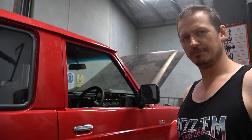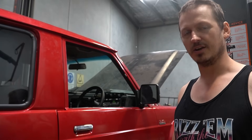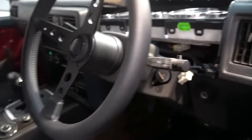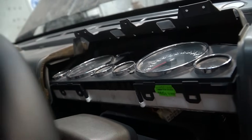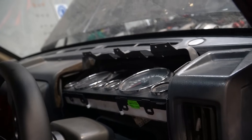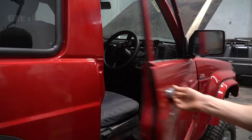Now, unfortunately, for this part of the build, I have to make a compromise that I'm not particularly happy with. For almost the entirety of this build, everything has been done and it's kind of met my standards. But this is one of those things I can't really get around. Canbus works relatively independently from all of the other systems of the car, and the bridge between them is something called the Canbus Gateway, which allows all the computers to connect with each other. Unfortunately, mine is actually built into the gauge cluster in this car. So sadly, removing it is not really an option, and due to the style of Canbus it's using, there isn't a module I can just simply swap out and hide somewhere. So I'm going to have to hide this gauge cluster behind where my speedo goes, which is less than ideal, but as long as I can just forget about it, it won't be a problem.